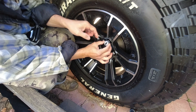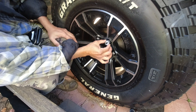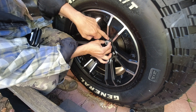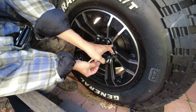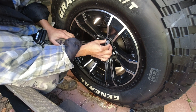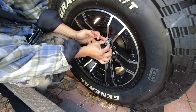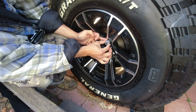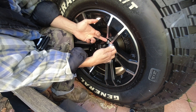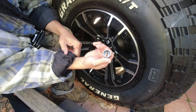There are many positions to place the wheel nut indicator based on having the arrow point at an obvious position — it could be pointing at this edge or that edge — but over a long time I'll be forgetting whether I pointed here or there, so I will just make the tip of the arrow point upwards to the center. That way if the nut loosens it will turn away from the center. The flat face of this hexagonal nut is 19 millimeters, so this caters to the 19 millimeter flat face hexagonal nut.